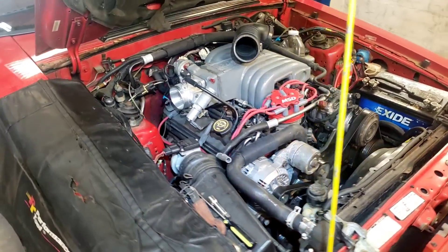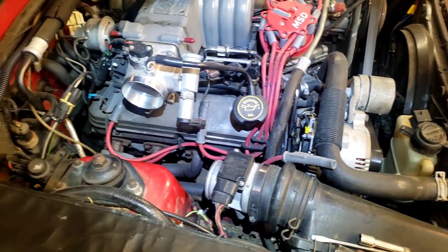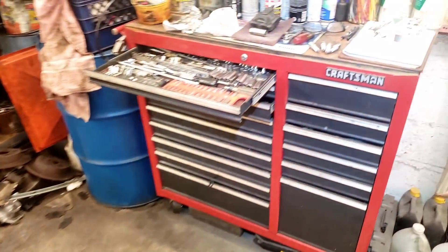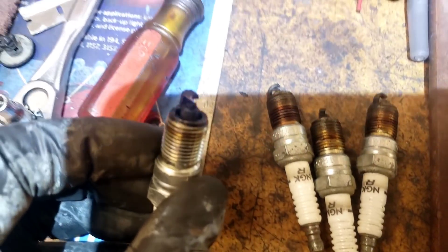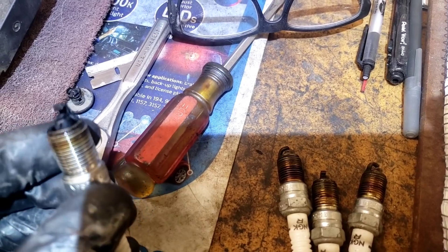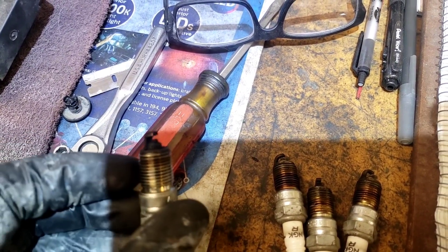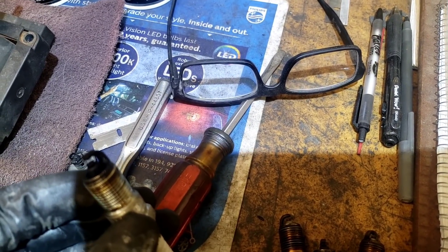We're working on our not-so-fabulous Ford Mustang. Pulled all the plugs out of here. I'm tracing out a miss and most of the spark plugs look pretty good except this one — see that one? It's a little wet. We're gonna put some new plugs in it. I don't know why that's wet; it's got some oil on it. Concerns me a little bit. Let's put some new plugs in it and see what happens.